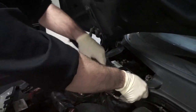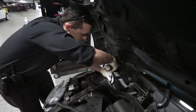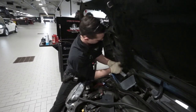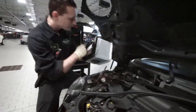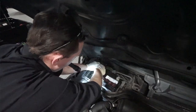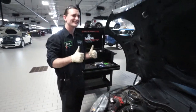To replace it, we're going to remove the necessary items that are in the way. In this particular case, it is the passenger cowl, partially the wiper arm if it is in the way, and the battery hold down. Then we're going to disconnect the terminals. After we disconnect the terminals, we'll remove the battery. We're going to reinstall the new battery, put the hold down back together, positive and negative cable back on, and the subsequent pieces covering it — in this case the cowl piece.